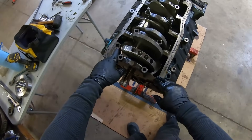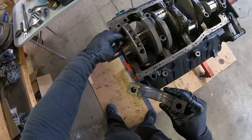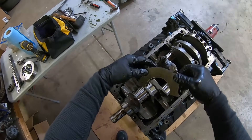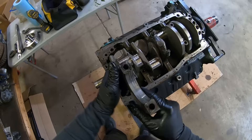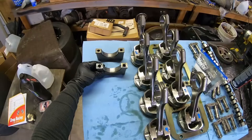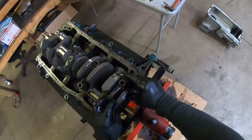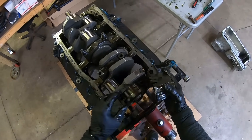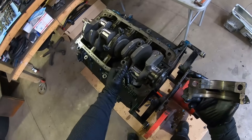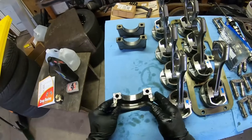A majority of these caps are already ready to pop off. This is number one cap - definitely gets a lot of load, looks really good to be honest. Had something go through it but doesn't really catch my nail on the crankshaft, so I'm pretty happy with that. Number two - a little more wear than number one, had something definitely go through it right here. Probably some of that turbo material it ate at the track. We might be able to get away with just polishing this crankshaft. We had our crankshaft at about two and a half thou clearance. Let's go back to number five - that actually looks really good. Not really catching anything there. Rule of thumb: if you catch your thumbnail on something, it's got a gouge in it. Makes sense why the thing still held almost 60 PSI oil pressure three years later.